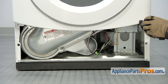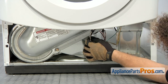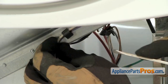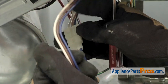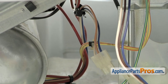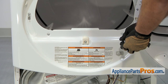We're going to use our quarter inch nut driver again and take off the two lower screws. In order to get the front panel off, we have to take the door switch wiring harness off. There's a little locking tab right here holding it on to the ducting. We're just going to lift that up and take the wire harness out. Once you have it released, then we can pull the wire harness out and use a small screwdriver to take the plug apart. Once you have the wiring harness disconnected, we can continue to remove the front panel. With the door switch disconnected below, we're going to open up the dryer door and use our Phillips screwdriver to take out these screws that hold the lint screen housing to the front panel.